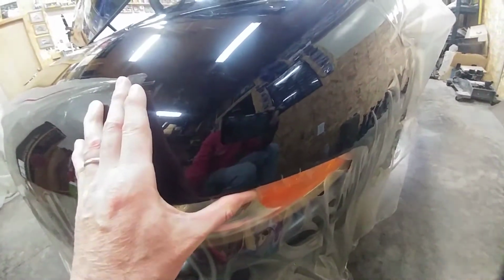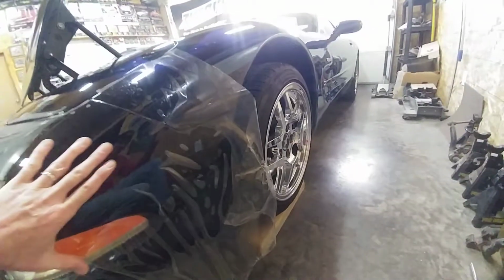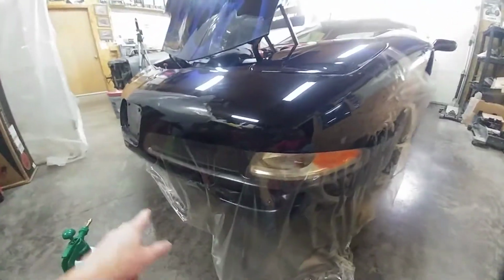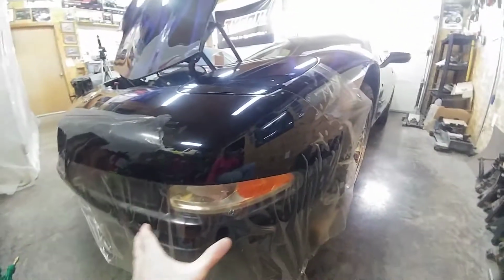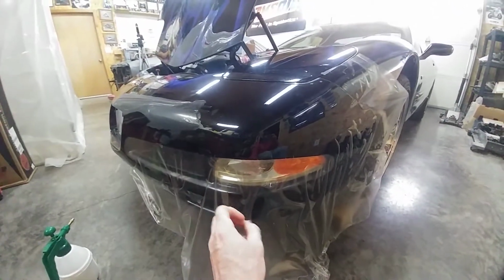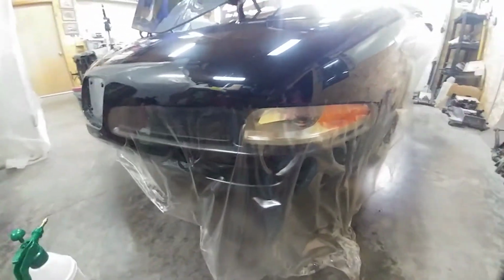So I need to continue to work this water out here, work this all up around the edge, and then you can start to see the next pieces I'm working on. Now, as I flow all of this down away, what tends to happen is you start to see all this big bunch in here, right? So I can flow that side in to roughly the brake duct again, and then I have this big massive wad of material. So that's the reason for the split. I can get it formed around there, but it just bunches up right here. So by splitting it essentially at the smallest point, somewhere in here is the piece that you really won't see.